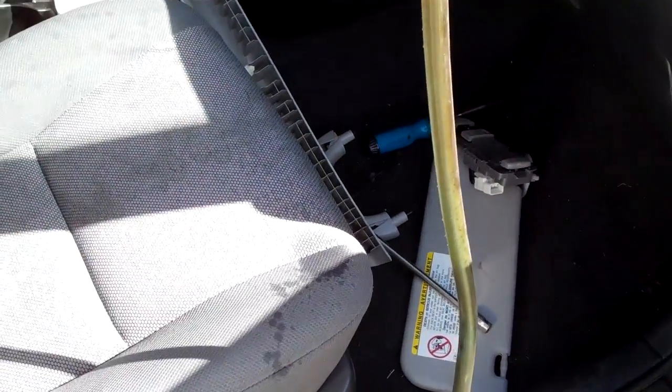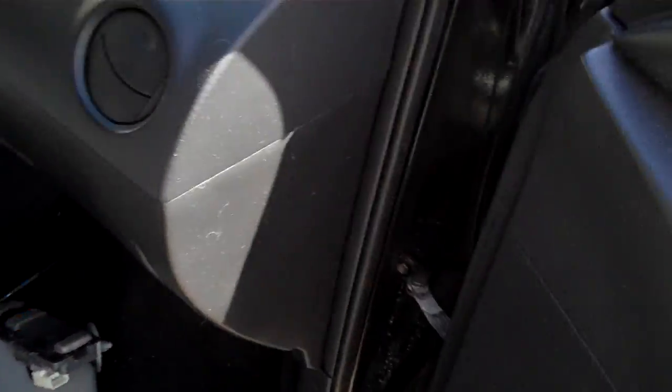It's dripping on the seat, as you can see there. And yes, I'm going to sit right in it. I've been hosing down the roof. I pull it down, and here's our leak right here. It's leaking from the windshield seal, and it's going down into the headliner. And from the headliner it goes over sideways here and drips on the seat, but the leak is most definitely from the windshield.